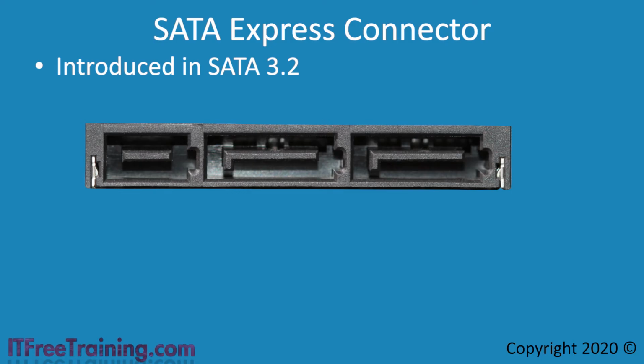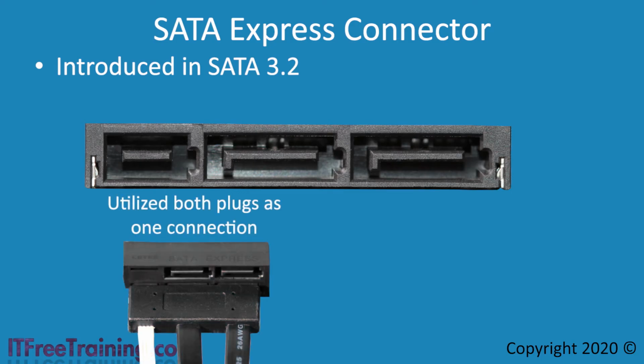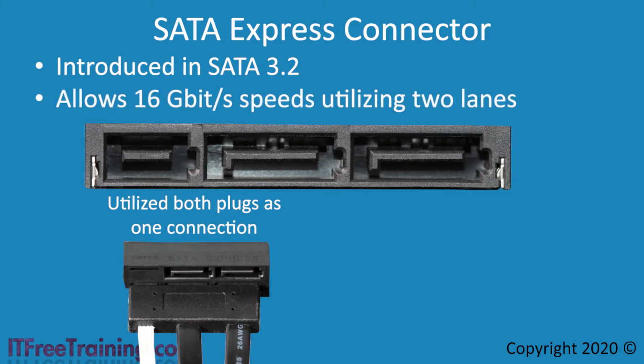To use the SATA Express connector at full speed, a cable is plugged in which uses all three of these ports. SATA and PCI Express both use differential signaling to transmit data. This means to support both directions, a minimum of 4 data pins and 4 ground pins are required. In order to get higher speeds, SATA Express uses 2 lanes. This allows for speeds of up to 16 gigabits per second.